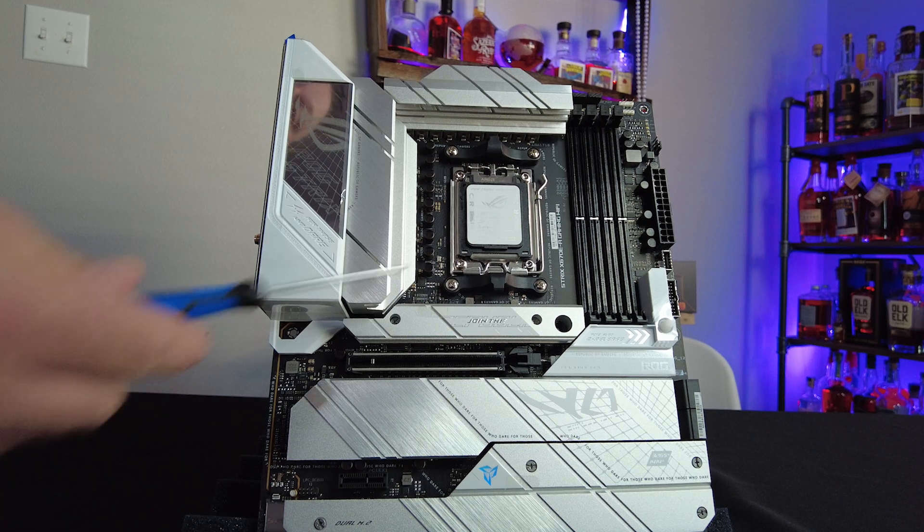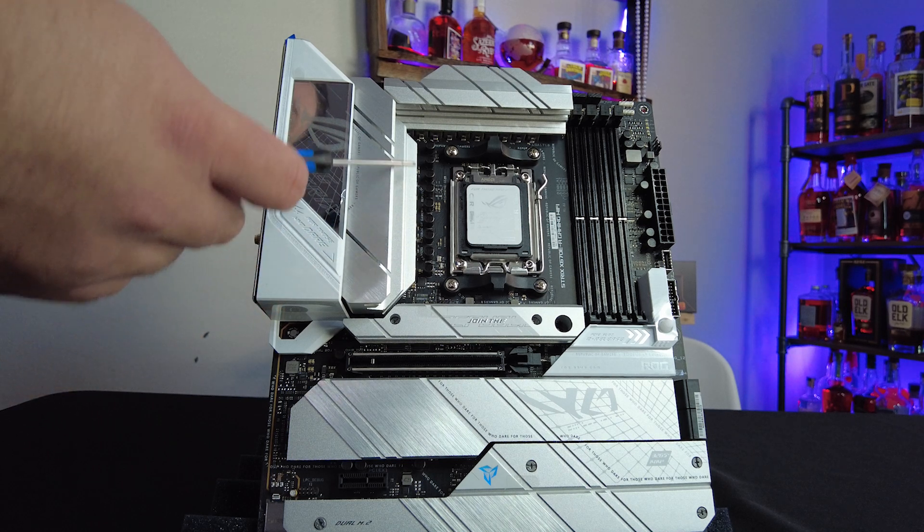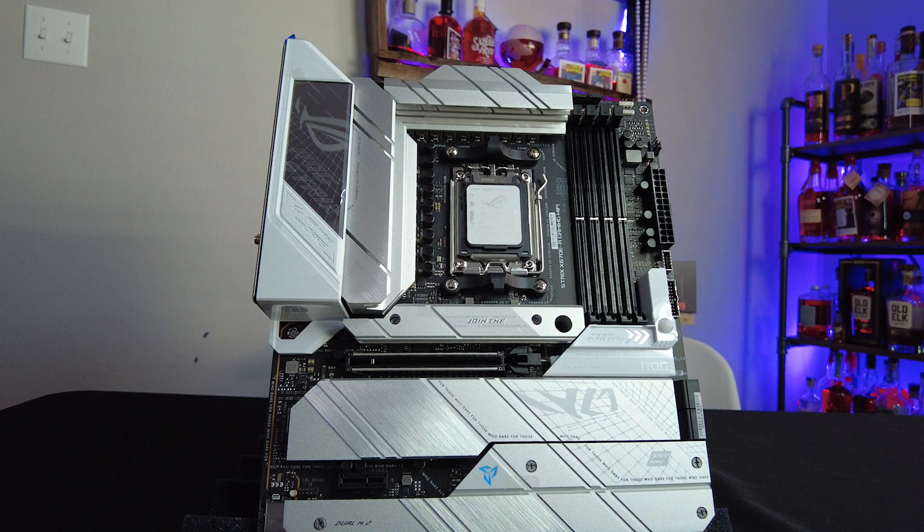If you even look at the VRM, the capacitors on this are excellent, high quality — ASUS made sure they designed it really well. On the topic of overpowered versus underpowered, another YouTuber — I'll link this in the description — did a test on a similar VRM with the heatsink completely removed and a 7950X. He still barely cracked 75°C. So worst case scenario, this bad boy won't even get warm to the touch.